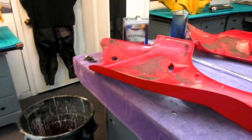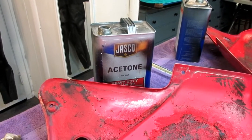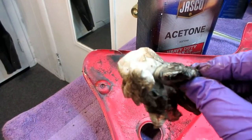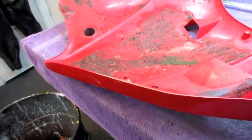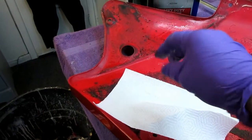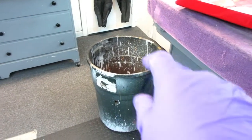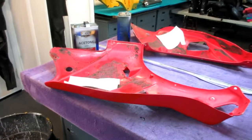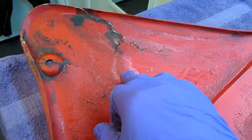Here's a really good tip: when you use acetone indoors, keep a clean garbage can right here. You've got a bunch of paper towels that still have acetone on them - as I'm cleaning this part I'll do one little spot at a time, get rid of that towel, get a brand new one soaked with acetone, do another part, throw it away. As soon as you're done using the acetone rag, put it outside - first because it's a fire hazard from the fumes, and second it's not really good to be breathing gallons of acetone in an indoor environment.